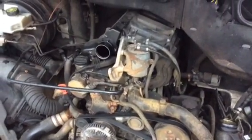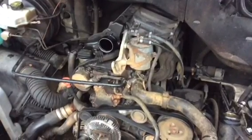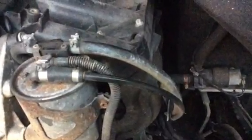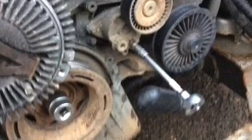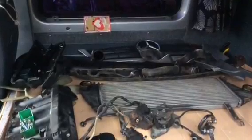And so you can see it's very easy with a set of star bolts, everything star bolts. You've got the diesel pump, and you just whip everything off in one go. You've got diesel filter, just make a note of where all the pipes and leads go. And the tensioner on the belt, on the Poly V belt there, you can just put a torque on there and loosen it. Everything goes inside the van. Job done.